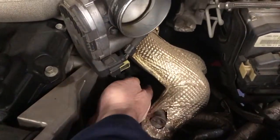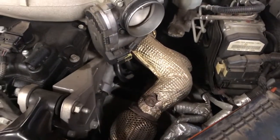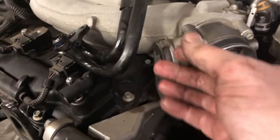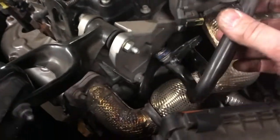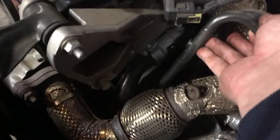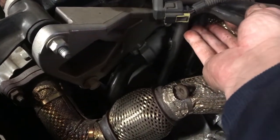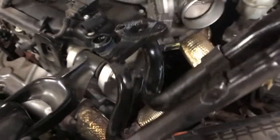With that out of the way, we can definitely get our hand in here a lot easier now. Let's go ahead and get a 10 millimeter socket so we can take that heater hose pipe loose. I think I've just dealt with the most difficult part of this job, and it is this tube assembly. It does come out in this fashion — these two pipes here — I'm showing you by sort of putting it back in. You will have to finagle it just a little bit, and it'll go underneath the throttle body and in between the exhaust. You'll have to turn it a little bit, but you don't have to force it. It will come out.